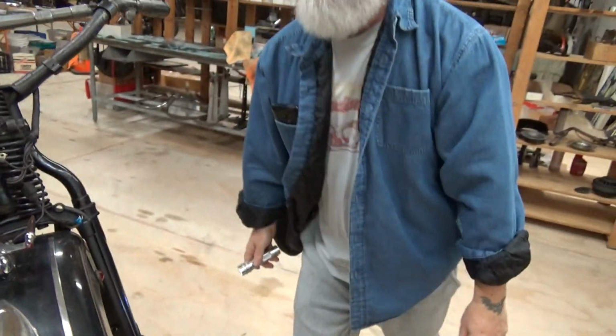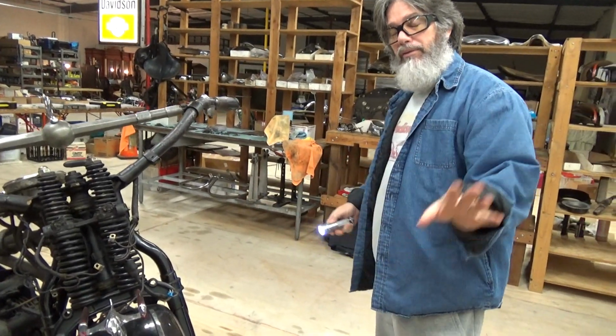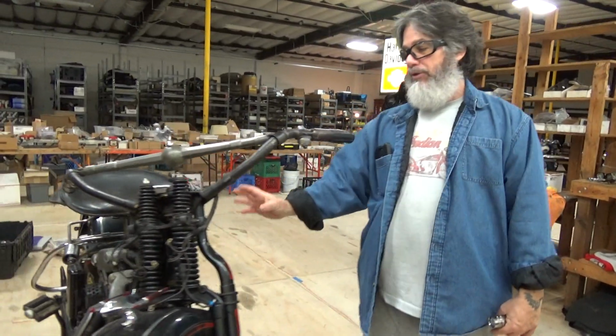So we can definitely say we have no butterfly stays underneath by the time they changed the frame and the fork. Changed the butterfly stays. So that was a mid-year change again in 38. So your early 38 would certainly have butterfly stays. Now that doesn't necessarily mean that today we're stopping that, boys, and we're starting some of that. What it means is by the time this bike got made, we're done with the butterfly stays. The new style fork is here, and the new frame is here.